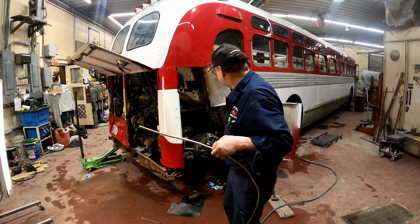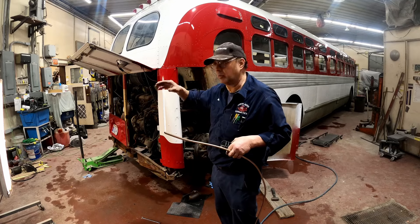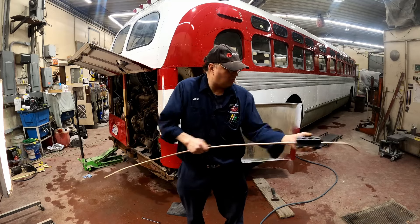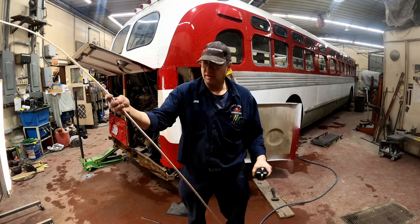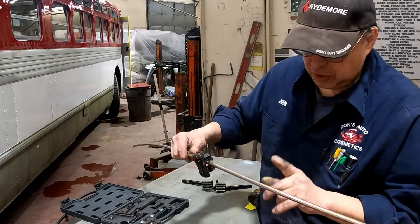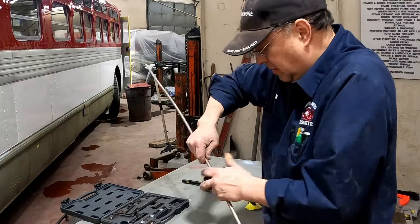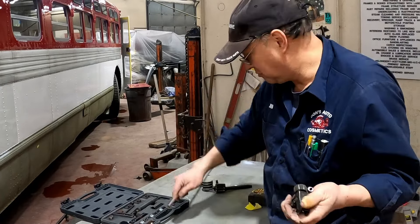I'm helping Jonathan and Kate make some fuel lines. We need two — a fuel line that comes from the gas tank into the motor, and a return line that goes from the motor back to the tank. Jonathan's got this little machine that straightens out the lines — it takes out the bends, it's the coolest thing ever. This kit also came with an automatic style tubing cutter. Whether it's soft — like this nickel copper stuff — or hard steel line, you just screw it in until it hits, then twist it. You keep buzzing around, it self-adjusts, and about ten times around, it comes off. Ta-da!